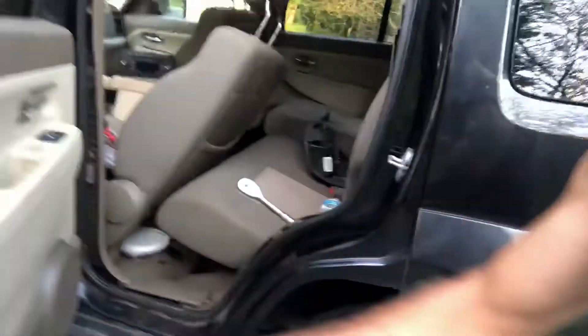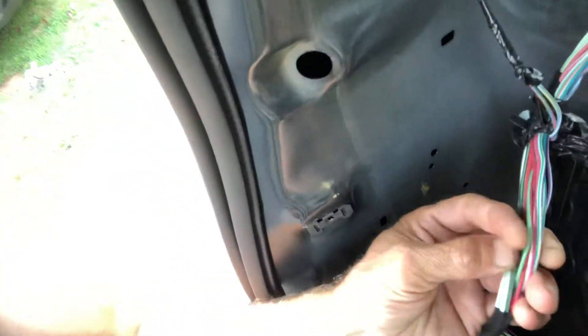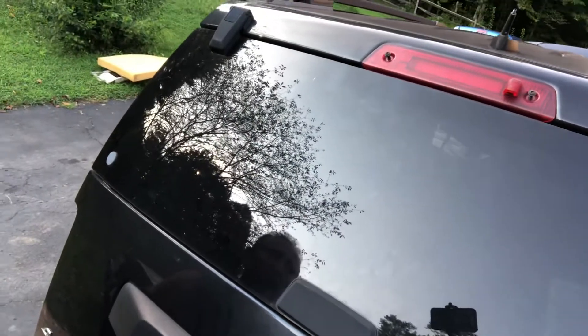Today I decided to check the power for the brake light switch. I found the wire connected to pin one — the power pin — on the brake light switch and traced it back all the way through the vehicle. It came through here; it's this green and red wire right here. This is the power coming from the brake light switch back to here, and this was powering the brake lights on both sides. Even the center top brake light came on and wouldn't go out either.